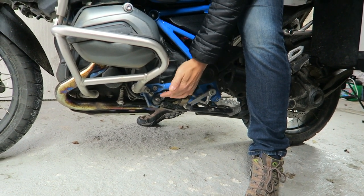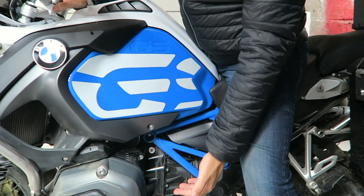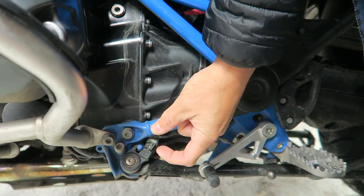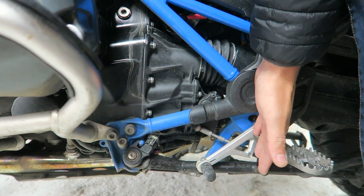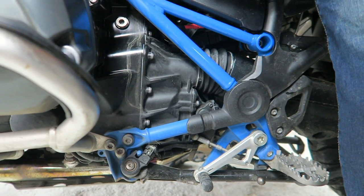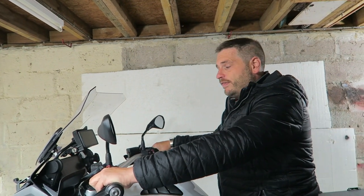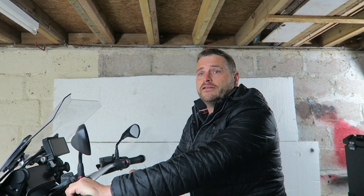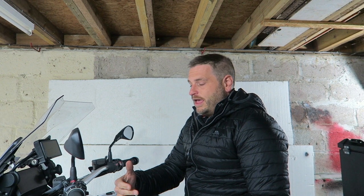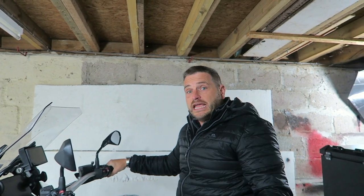There's also another thing for this bike — most bikes have got it, I think nearly all bikes have it. There's a sensor in here that presses in to press a switch, and when the side stand is down you can't select first gear and ride off. Nine times out of ten, when you select gear with the side stand down, the engine will cut out — it's a safety feature. And the amount of people who forget: I forget, Mark forgets every now and then.